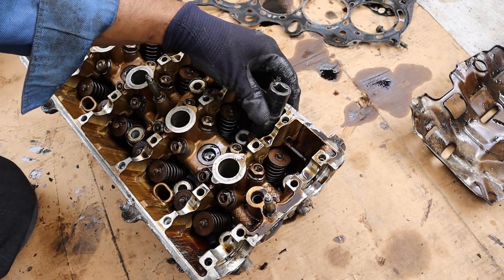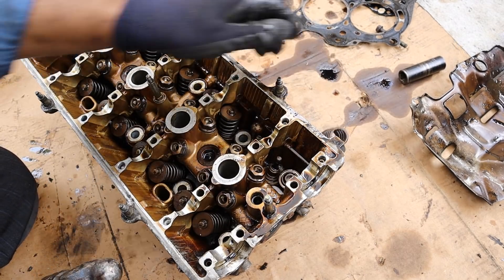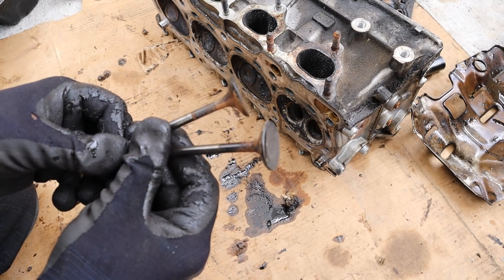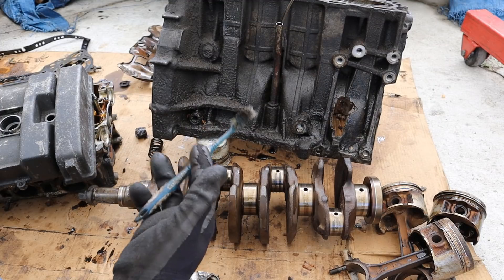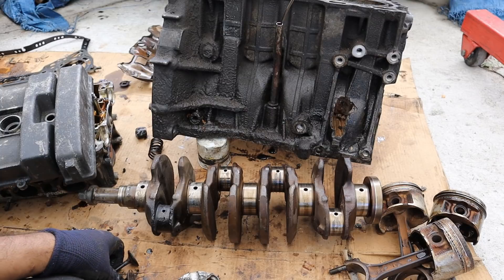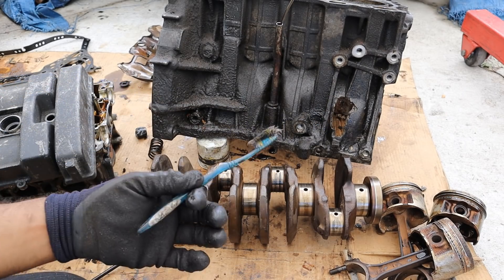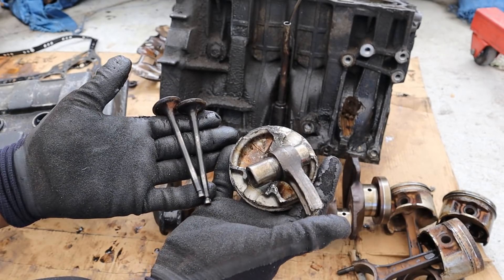Let's take a look at what those valves look like. These definitely look like they're bent, but I don't really see any point where the piston actually hit it, so it probably did light damage. By the way, these valves actually feel pretty meaty and very heavy compared to other engines I've felt. Now kids, if you don't want your engine to end up with bent valves like this one, or a spun connecting rod bearing on your crankshaft like this one, or a grenade piston, or a big inspection window in your engine — make sure you check your oil frequently, especially if your engine does not have VTEC on the valve cover. Make sure you subscribe if you want to see more videos just like this one.